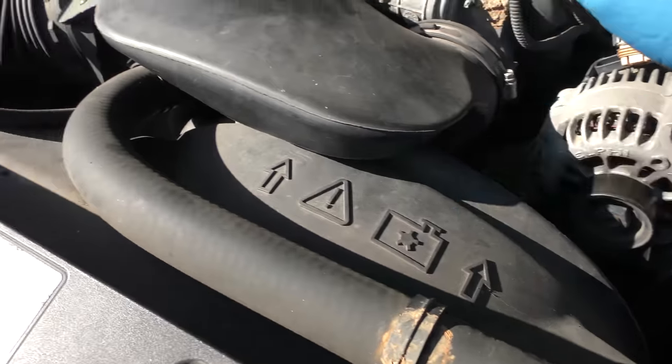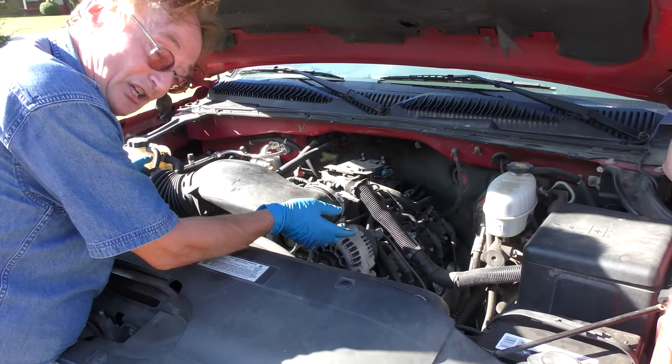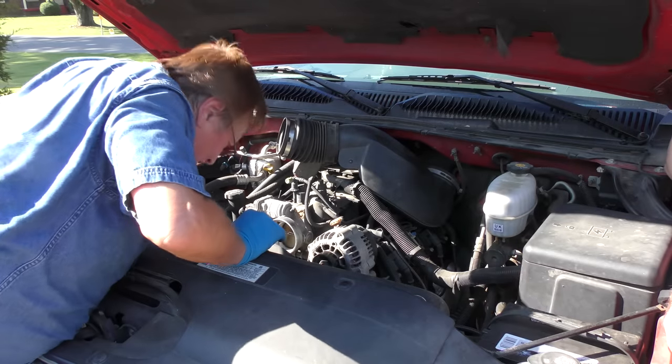In this case the only logical thing to do is replace the alternator. We've got to move all the plastic covers so we can get to the adjuster to get the belt off and change the alternator. So we'll get this stuff out of the way and see what we've got.